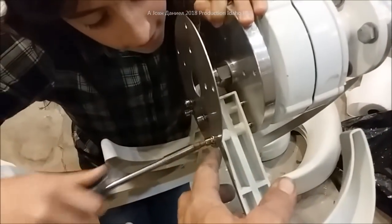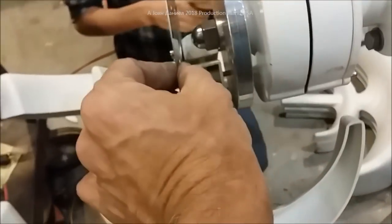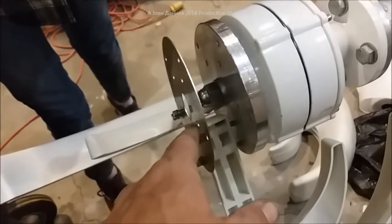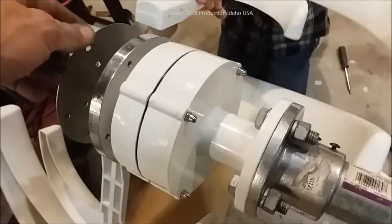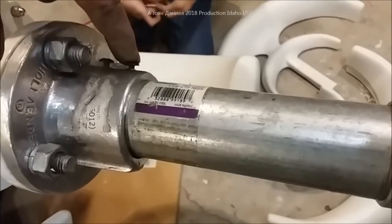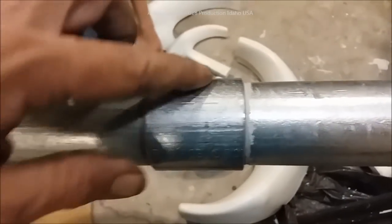All right guys, one thing you want to make sure you do — she's getting all these blades put on — do not tighten these down at all. This upper plate will warp super fast; it's not very thick. Make sure you've got your lock washer and other washer on it. She's just setting these in, and we're going to slowly walk it all in to make sure there's no problem. You will strip these threads out — be very, very careful. Over here you can see I put in my little safety screws; they're embedded in there, three-quarters of an inch long. I stopped them as soon as they came through so I didn't chafe any wiring, and the rest of the wire with that loop is right here at this joint.